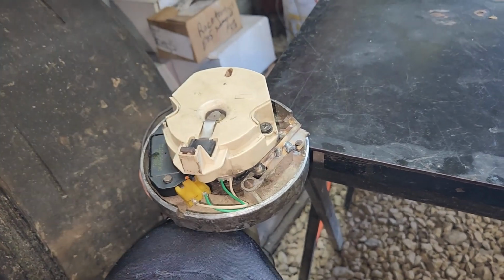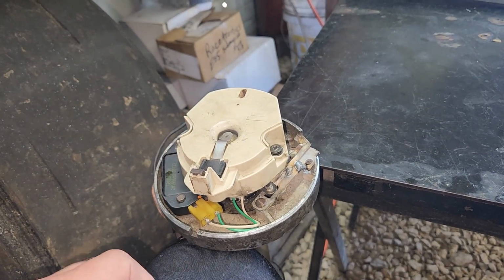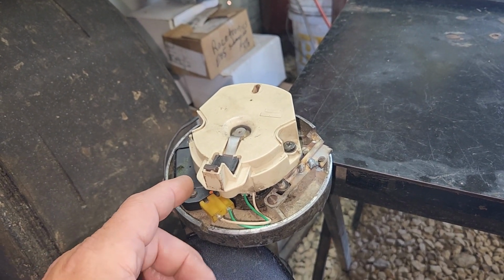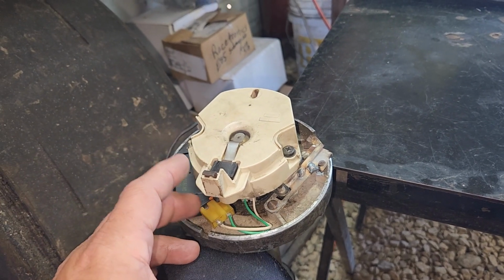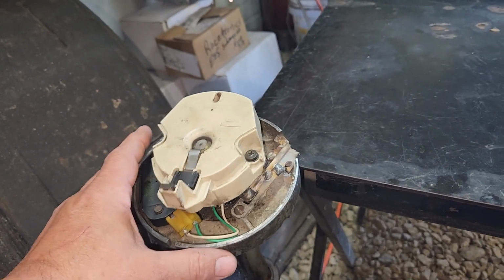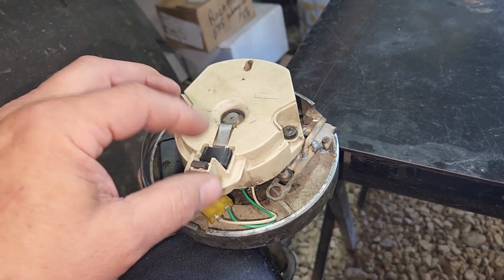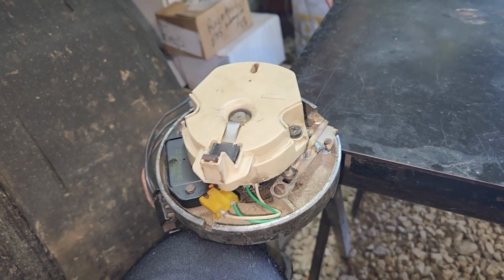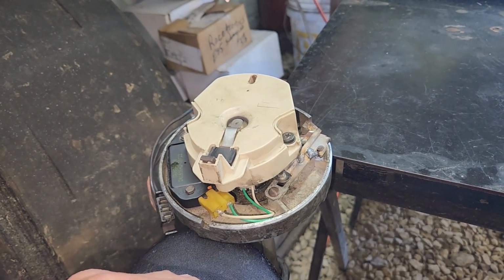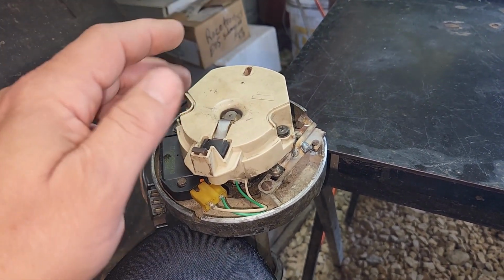So what I did was I bumped mine around until the distributor orientation was about right there, and then I grabbed a socket and a ratchet, and I turned it. The time mark on the balancer, and lined it up with a zero mark on the timing tab, and we put it at 30 degrees, because even with the spring in it, it was going to make 4 pounds of boost. So 30 degrees of time, 4 pounds of boost was perfect. So that's what I did. I just bumped it around till my other distributor was pointing at number 1, and then lined up my timing marks where I wanted the timing to be, and then dropped the distributor.